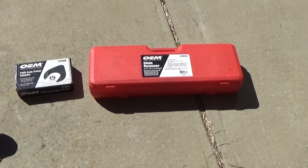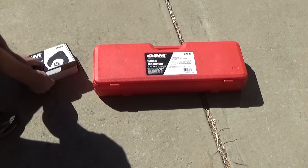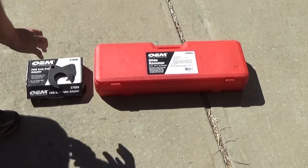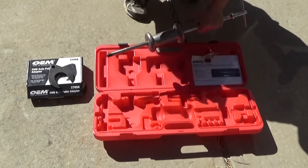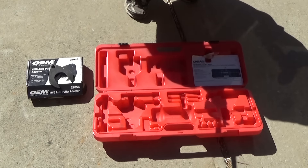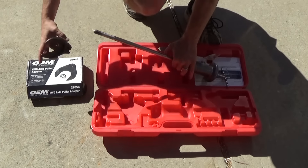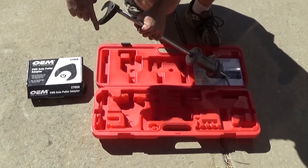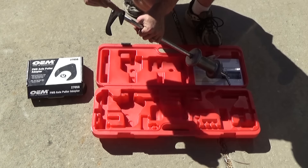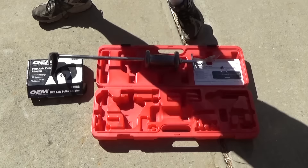It's really not pressure that it needs — what it really needs is the quick snap that a slide hammer gives you. Here's the adapter that goes on the slide hammer to help you pull a CV joint or an axle out, and here's my slide hammer — I picked this up from AutoZone. My pulley adapter is missing the nut for the bottom, but it's threaded so I didn't have any trouble with it, although it's not ideal.